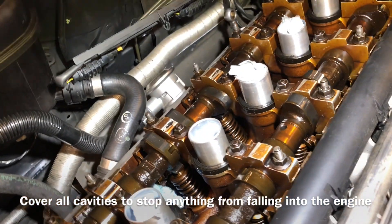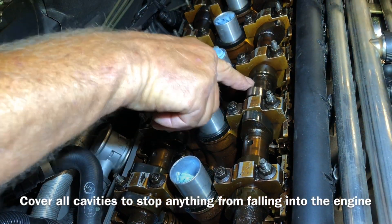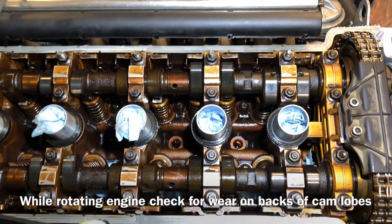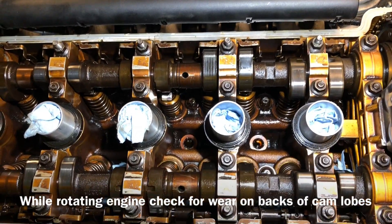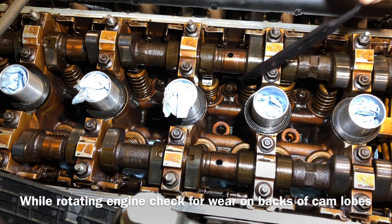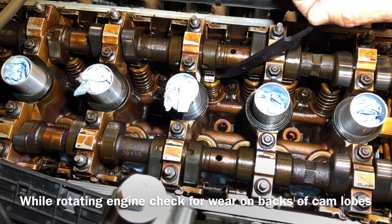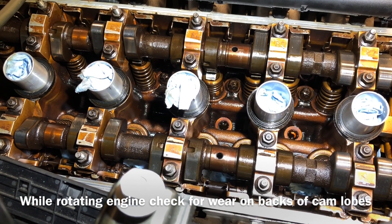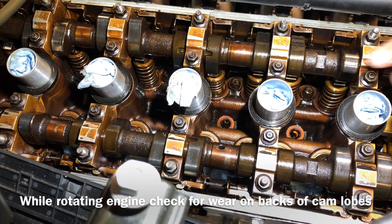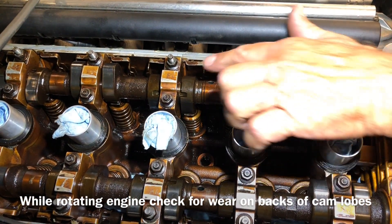We're going to do just the one cylinder since it's the easiest for the video, and I'll show you how to bring it up to the marks and set the lash. To set it up, the first thing you've got to do is bring the cam up to where we have the right lash position. As you can see, the cam right now is riding on the rocker arm assembly — that's the rocker arm assembly right here — and that's the valve. Between the valve stem are the shims. We're getting on the back side now of this cam.